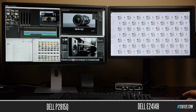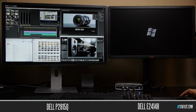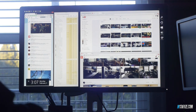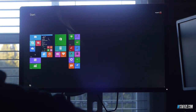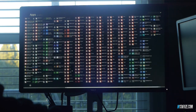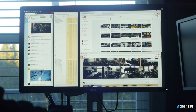With this particular Dell 4K monitor, you only have 30Hz at that 4K resolution. Our 24-inch 1080p is running at 60Hz. We can't see that difference on camera since we're shooting at 30 frames per second, but you really have to be here in real life to appreciate how the two monitors deal with motion and cursor movements. The 60Hz is better — it's much smoother, you have a better sense of control, and it just feels normal. With 30Hz, everything is halved in terms of frame rate. If you're doing photo or video editing, that's not going to be much of an issue, but you will notice that your cursor is not as smooth and responsive.